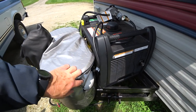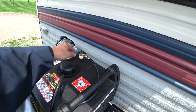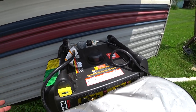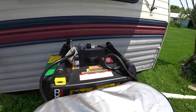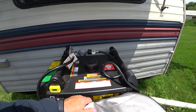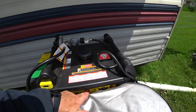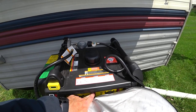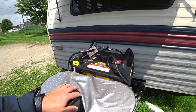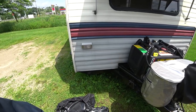I've got a hose running in here because I have a Y-fitting, and that Y-fitting allows this hose to be connected up. This is just the factory regulator that came with the generator. As it stands right now the propane's on — I only turned on one tank but both tanks are still connected. It would be nothing more than flipping that on, pulling the choke, turning the eco mode off, hitting the button — and now it's running.